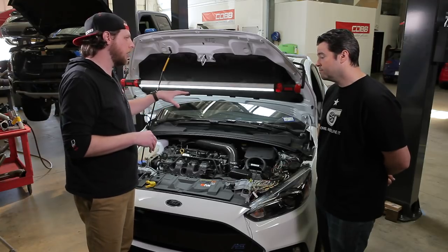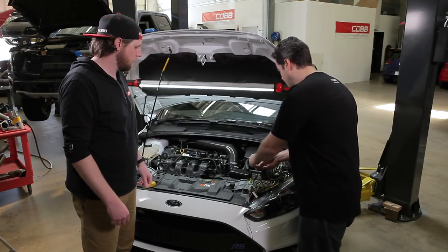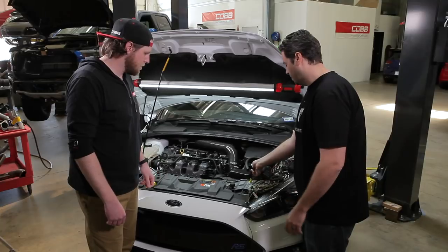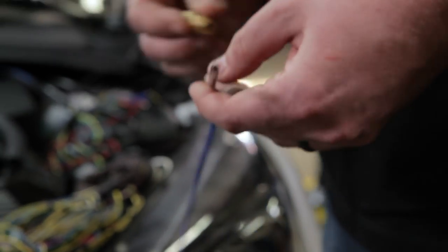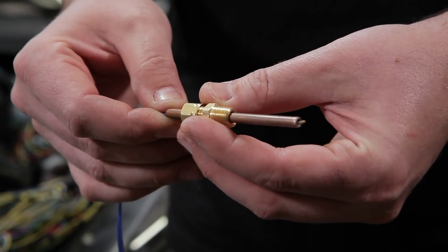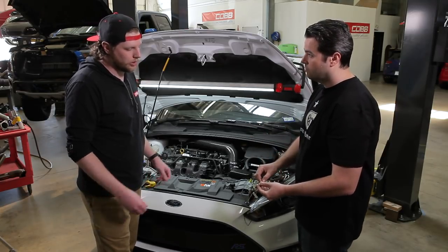Tell me in more detail about each part and what you used, why you decided to use those parts and what the benefit is. So as a baseline, we need to get ambient pressure and temperature. This is just an off-the-shelf pressure sensor that allows us to check pressure incoming into the air box — that's just world pressure. We've got an intake temperature sensor that we've mounted inside of a copper tube. The rest of them have an additional functionality that allows us to set the position of the sensor within the tube itself, because if you get closer to the wall you don't really get an accurate reading of the bulk flow. So it's adjustable to make sure that you're getting the most useful information.